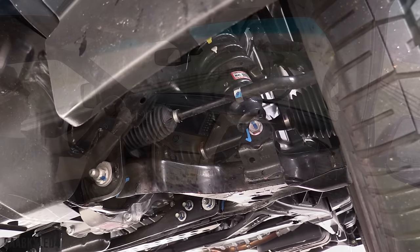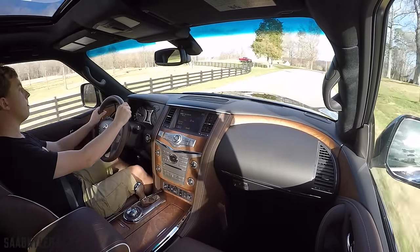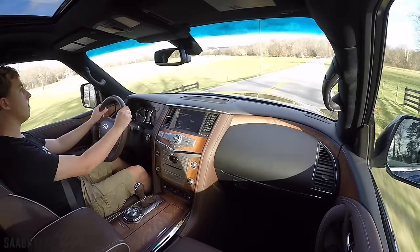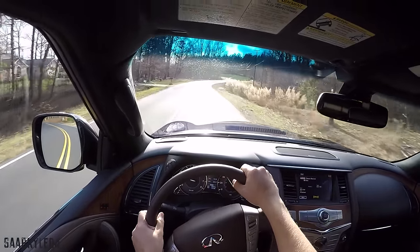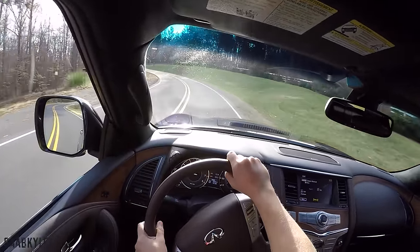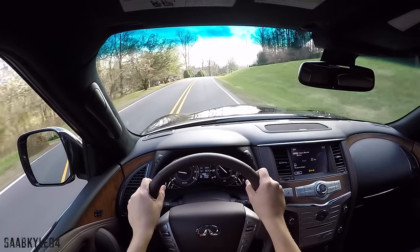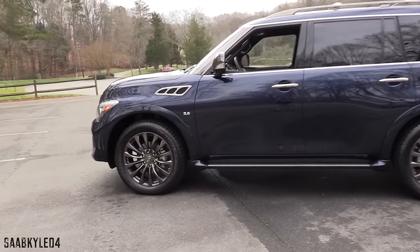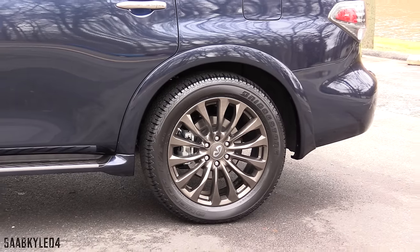The Limited was one of if not the best riding body-on-frame SUVs I've driven in a while, even with the 22-inch wheels. The suspension feels cushy and somewhat floaty over minor undulations. Through the corners, it's hard to overcome the laws of physics, but the QX80 handles itself pretty well. The rear suspension also features a supplemental air spring that functions as a load leveler to maintain ride height when carrying passengers or towing. It can tow upwards of 8,500 pounds via a standard 7-pin trailer harness. Approach, break-over, and departure angles are 20.9, 20.7, and 22.3 degrees respectively. Ground clearance is 9.2 inches. Overall length is 208.9 inches, width 79.9 inches, height 75.8 inches, wheelbase 121.1 inches, and curb weight for the AWD version is around 5,888 pounds.